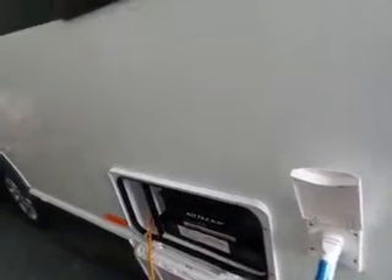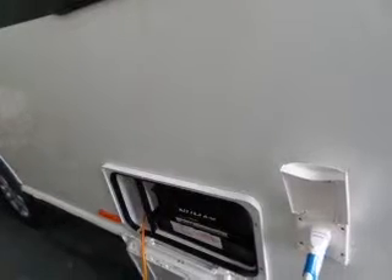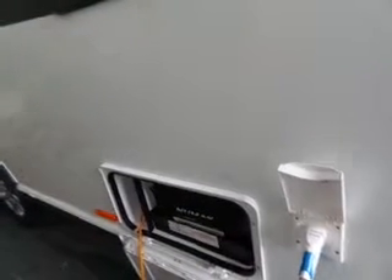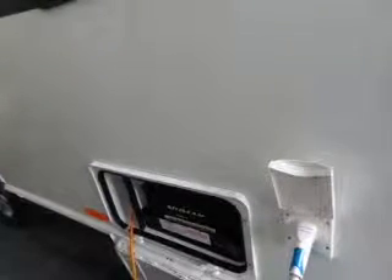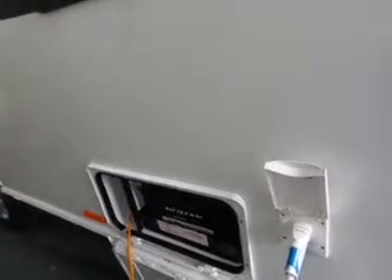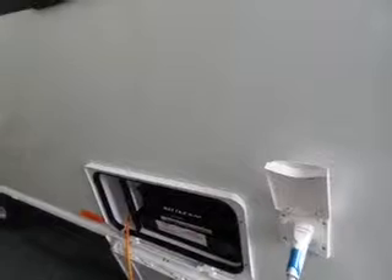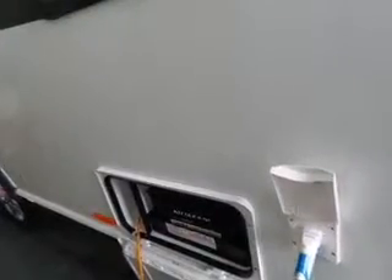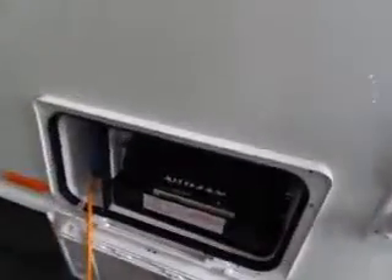That's the best thing to operate. If you go on rallies and things like that which haven't got any electric hook up, you can still work the water - the water pump works off 12 volt. You operate things on gas but you need the 12 volt electric or battery to actually light igniters and things like that on the van. But most of the time you'll be plugged into 240.